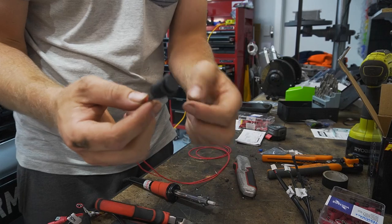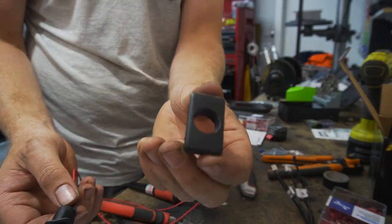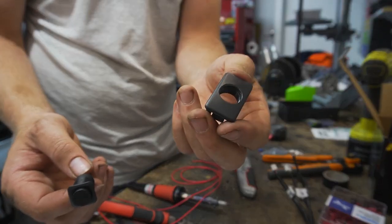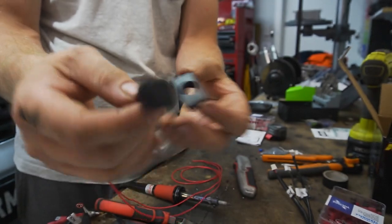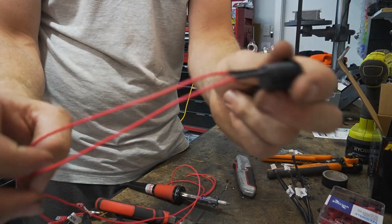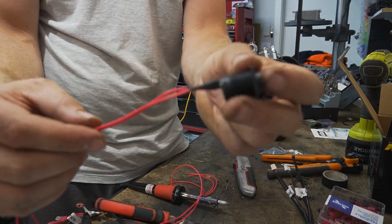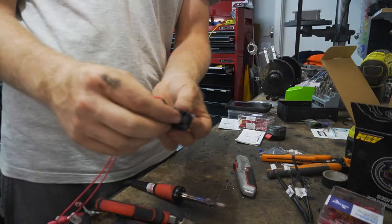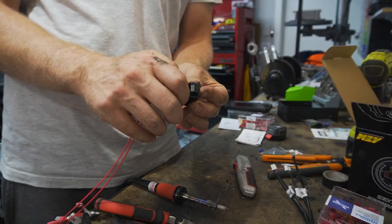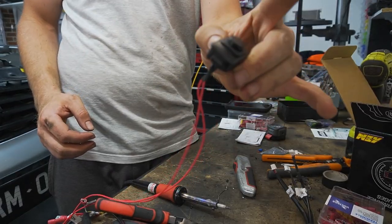For the illumination I've got this push-in-and-out on/off switch. I've taken one of the empty blank switches out from under the dash and I'm going to mount this in it. I've soldered and heat-shrunk the ignition source for the illumination onto it so I can turn it on and off manually. It has a little locking nut that does up on the inside and just looks clean to turn the gauge light on and off.